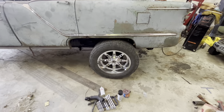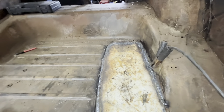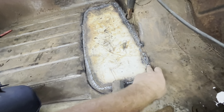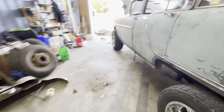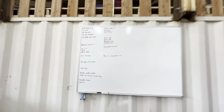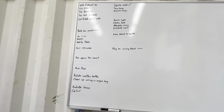I made this little cover for the fresh air inlet where the fresh air goes into the cab — I just blocked it off for now and put a couple of grommets in there. I'll run all my wiring and gauge wiring through there. I've still got this to cut out — it looks awful right now and it's probably going to look kind of weird when I'm done, but I don't care. I got the trunk pan where the spare tire used to go welded in. It's getting really rusty in a couple of spots so I'm just going to put some seam sealer on it. I'll do a little patch here and then seam sealer across there.